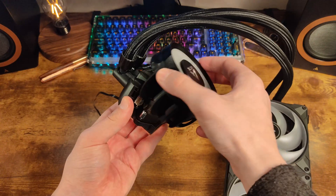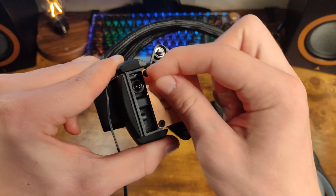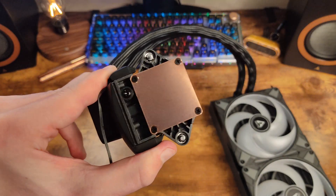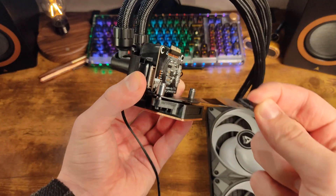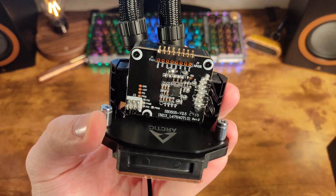The VRM fan module is simply docked and held in place by magnets. The base of the heat sink, directly adjacent to the processor cover, is a copper plate. Its outer surface is ground and slightly polished. Towards the center, the surface is convex with a difference of about 0.1 millimeters. The dimensions of this plate are 44 by 40 millimeters, and the inner part, limited by holes, is 33 by 29 millimeters.